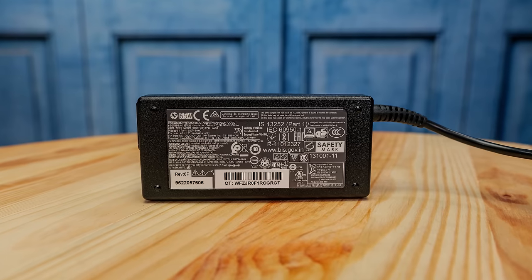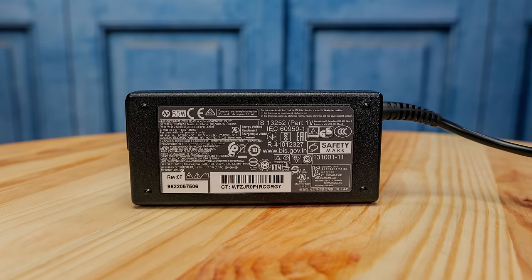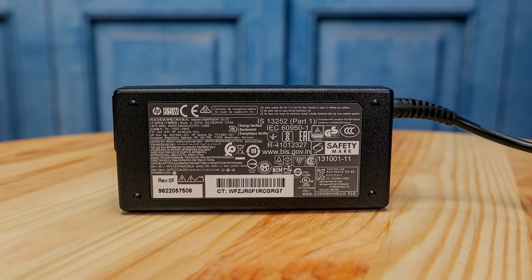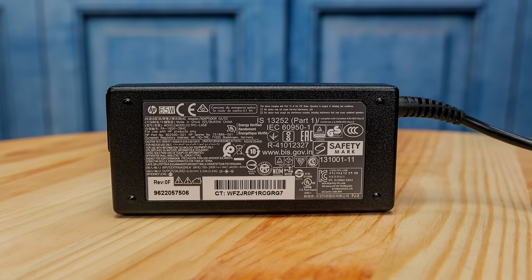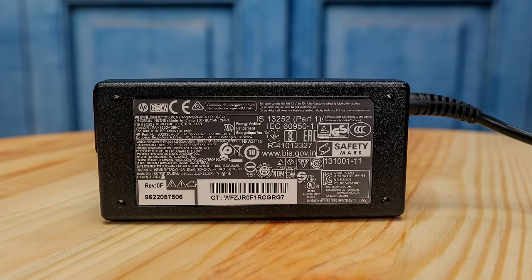In terms of power supply, we got a 65-watt PSU and we managed to get well over 50 watts — around 54 watts — in the system under load, with idle still around 11 watts, so it's very reasonable. If you're going to load this thing up with heavy workloads, lots of USB 3.1 Gen 2 devices, and two NVMe SSDs, you're probably going to want to get a 90-watt power supply from HP because those devices combined with the CPU will exceed what a 65-watt PSU can handle. A lot of these systems did come with 90-watt PSUs, but we only got a 65-watt one with this particular unit.